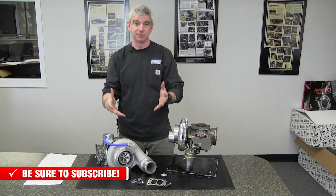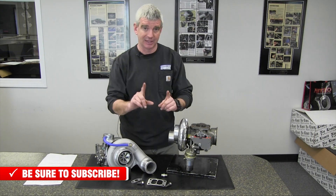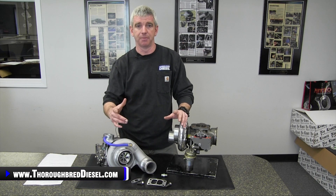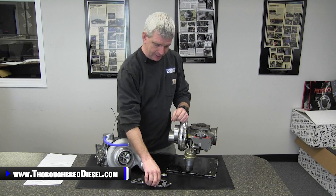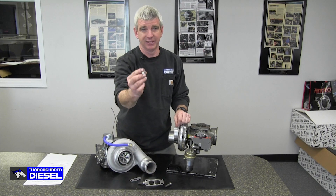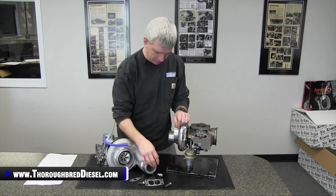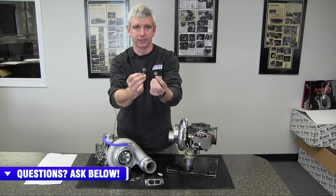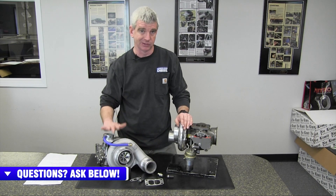Of course it's made for that. If you guys decide you want to do an HX40 housing on that, give us a call and we'll set you up with something inside of the kit. Now for you 04.5 to 07 guys, you are going to have to purchase a wastegate puller — that will be a separate add-on on the cart on Thoroughbred Diesel. We can get you one very cheap, but you will need it to keep the truck from throwing codes. It will come with the T3 foot gasket as well. You'll have your oil drain gasket and your oil inlet conversion — this is an NPT to the O-ring thread that comes with the Cummins line, so you don't have to worry about running down to your hydraulic shop. They include that. And then you're going to be adding two studs on the manifold for this fat shaft turbo because the turbo foot is smooth on both sides, so we're going to go to the stud setup on that.